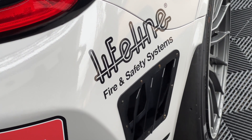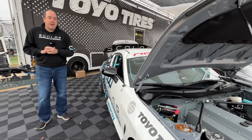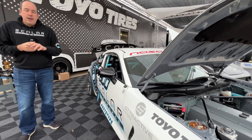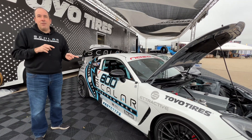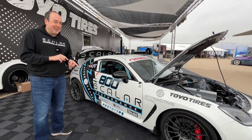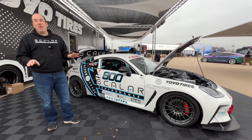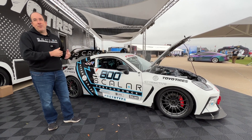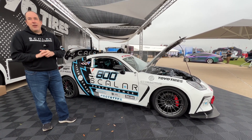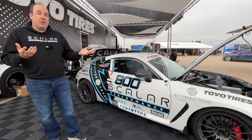We're standing in the Toyo booth — Toyo is our preferred tire. Outside of sponsorship, the wear is amazing. They're a 40 treadwear tire and they stick amazingly all the way to the end of their life — very consistent. We'd love to get a wider tire because the car makes so much power, but these work really quite well. A lot of people ask if EVs need a special tire — the tire doesn't know what the powertrain is. It's completely oblivious to what fuel is being consumed. At 3,200 pounds it's a similar weight to the M2s we run against, so the tire is perfect.